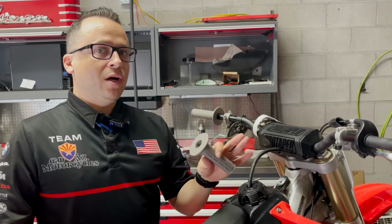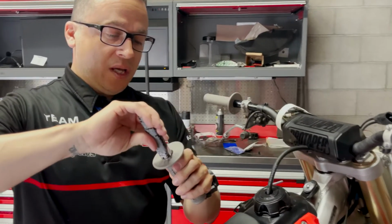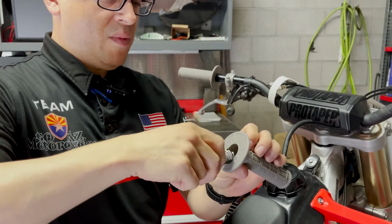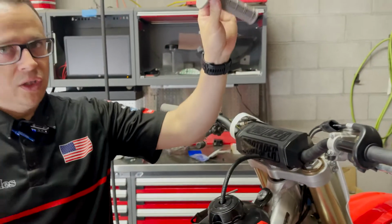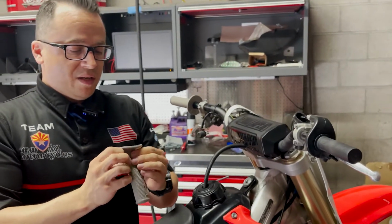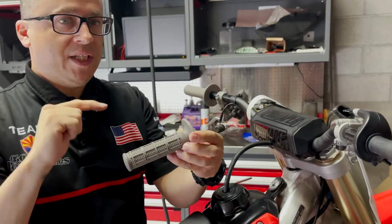We're going to go on with our throttle side grip today. And we're just gonna, again, put a small amount of this Honda Bond cement right in there. Just gonna move it around so we've got it all the way around. A little goes a long way. So what's really nice about it, makes it last forever. And again, we're going to mind where our waffling's at.